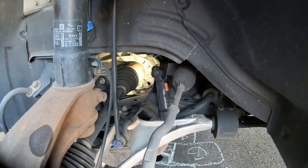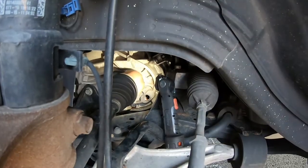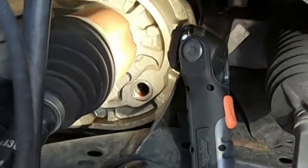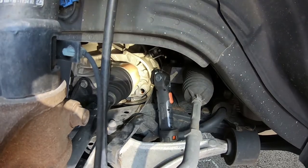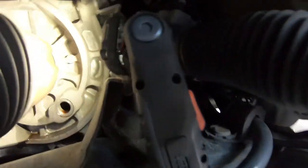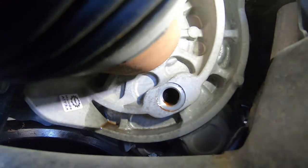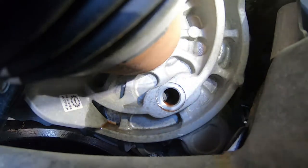So we've got the flashlight down there — the one that got busted. Can you see in there? Where that hole is, where it looks kind of wet? I'm going to pour in oil from the top and I need you to let me know when it starts to come out of there. One of the things I mentioned earlier: this fluid is $33 a quart — maybe you can find it cheaper. I've got two bottles of Acura and two bottles of Honda; they're both the same thing, ATF Type 3.1. It's 2020, so they're on 3.1.